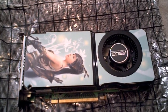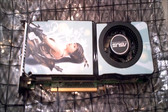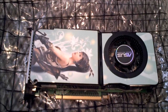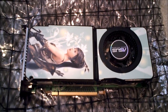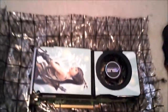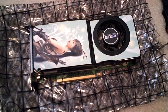Basically what they did — this isn't even a 9800 GT anymore really. I don't know why they even called it that, probably just to keep it cheap because it was like $180 brand new back in the day. Anyway, this is based off of the 8800 GTS slash 9800 GTX. It has 128 stream processors instead of 112 like the normal 9800 and 8800 GTS. It still has 512 megabytes of GDDR3 memory, and I believe that runs at a full 2000 megahertz on this. Also it's a dual-slot cooler instead of a single-slot cooler, which was really my only gripe with the 8800 and 9800 GTS — they'd overheat unless you put an aftermarket cooler on them.